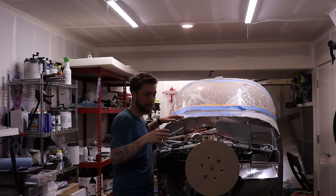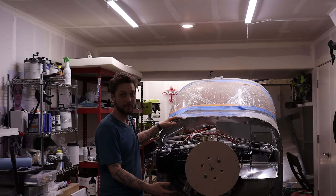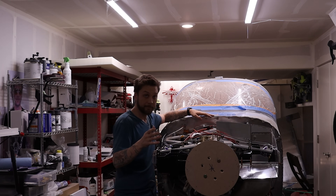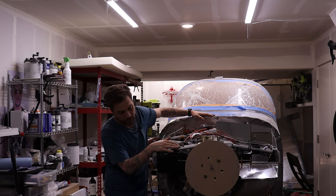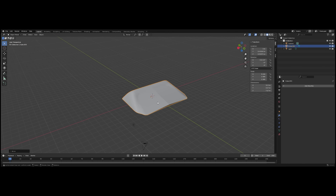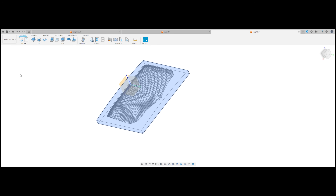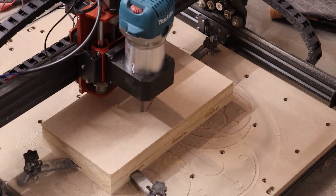Needing a win, I thought I'd address another aspect of the engine that throws a curveball — the mixture arm. It touches the bottom cowl; there's a little bit of rubbing, and it's not uncommon to need to put in a little blister. I figured a blister is one thing, and I've seen some people do a little eggshell-shaped bubble on the bottom of the cowl. But of course I had to complicate everything. I went ahead and designed in CAD a nice looking symmetrical relief on the bottom of the cowl — it almost looks like a little scoop. In fact, I've been calling it that. My thought was to mill it on my little milling machine, then glass over it and get it integrated into the cowl. The milling machine, per usual, turned into a nightmare.